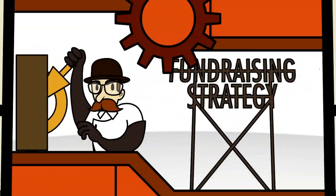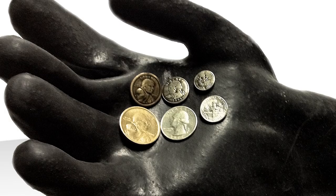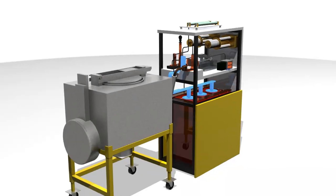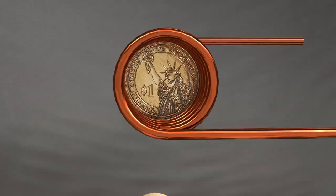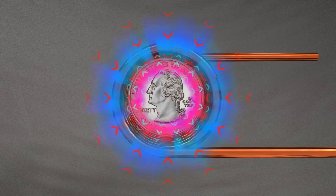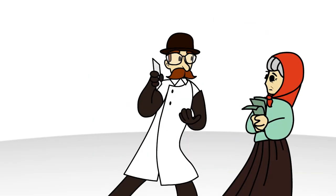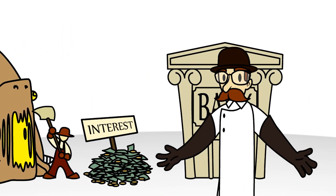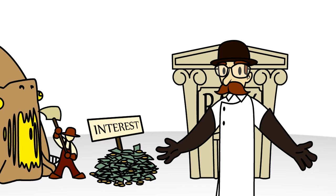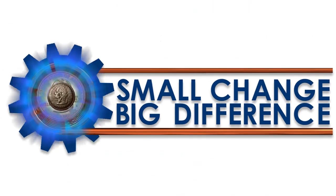Here at the Geek Group, we've invented a new fundraising strategy. You can now purchase impressively tiny coins we've compressed using high-energy magnetism. We induce a current pulse of 100,000 amps into a copper wire coiled around a golden dollar, dime, or quarter, producing very powerful opposing magnetic fields that compress a quarter to the diameter of a dime, which you then receive in a lovely commemorative package along with the satisfaction that can only come from helping the Geek Group build our endowment. Available at thegeekgroup.org.